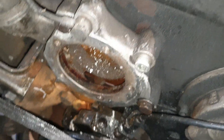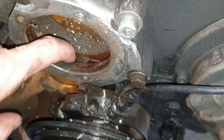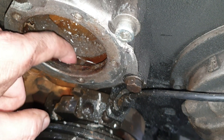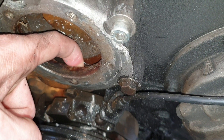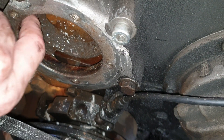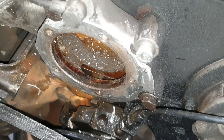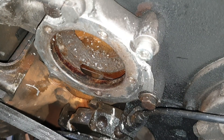I scraped off the mating surface pretty well — all super smooth. You can see the line where water would come up to and then drain out through that relief. Also, see this little hole here? That actually goes straight through into the water section, so it can also leak out through that one. I don't like using silicone sealant if I don't have to, and the new pump came with its own proper gasket, so I'll be using that. Hopefully all is well.